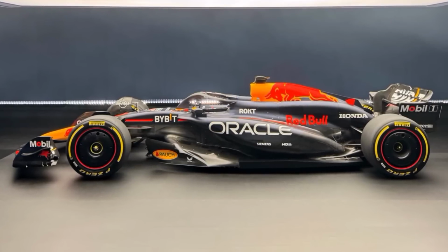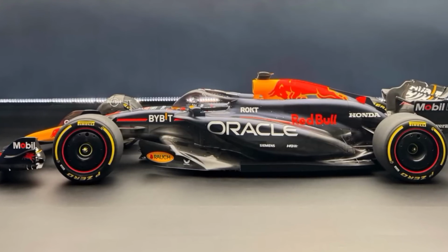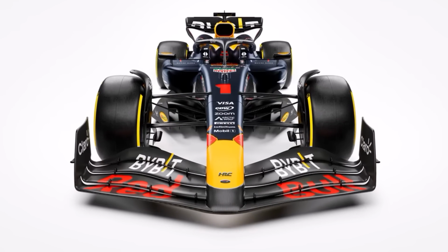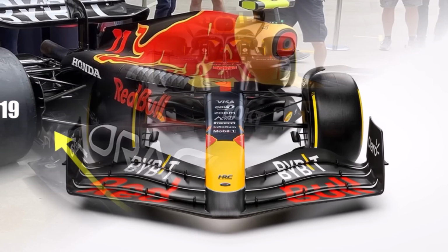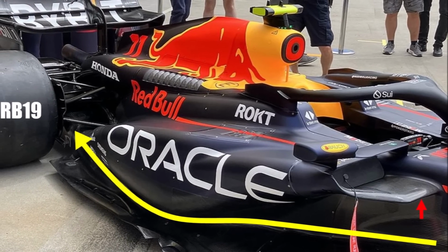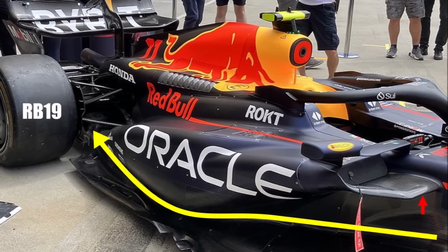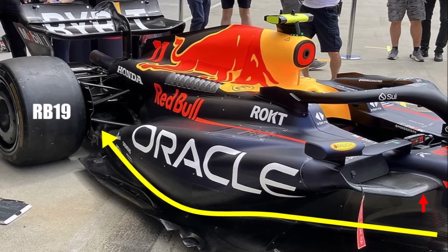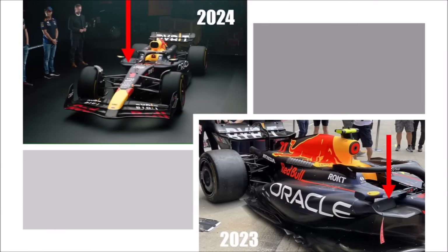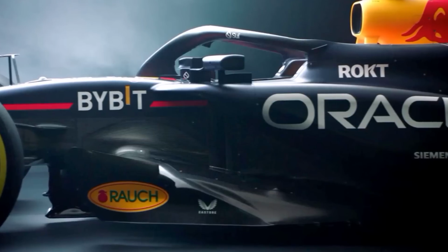But as always with Adrian Newey designs, the most interesting bits are usually not the ones in plain sight. So funny about Red Bull's rendering was that we couldn't see any inlets except the airbox. In the past, Red Bull moved the lower inlet lip higher and higher to push more air into the undercut area. That way, they get more clean air around the sidepods to the back to produce downforce, and they keep the front wheel wake outboard. So the inlet was on top, but now there's no inlet anymore. Instead, we could see some structures which looked like a vertical inlet.